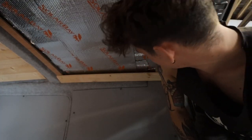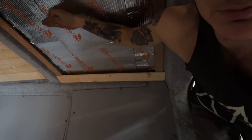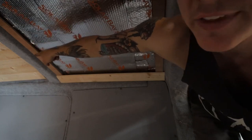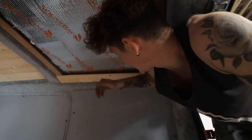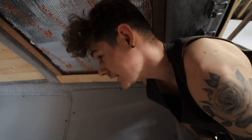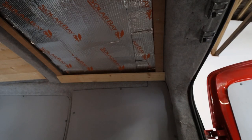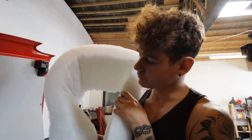That looks all right. Now, all we've got to do is just put the boards in, like you can see on that side. So yeah, should we crack on? I think we should. All you've got to remember as you're doing it is, I'll do like two, and then you've got to remember to feed your insulation in, which is up here. I've had to break it in half. So the insulation, obviously, this is the insulation we're feeding in, but I just need to split it.